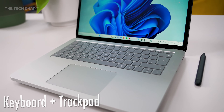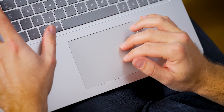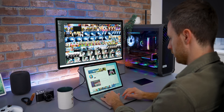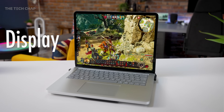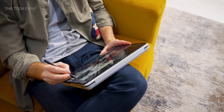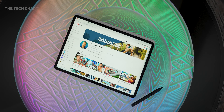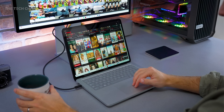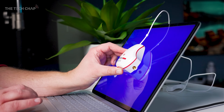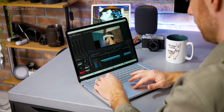Being a Surface laptop, you get a great keyboard and a big haptic trackpad. Both are very comfortable to use — the keys are well spaced and accurate to type on. The touchpad now has an adaptive mode which disables multi-touch gestures and looks for multiple points of contact and movement instead, which should make it easier for people with different physical input needs — it's kind of like an accessibility option. As for the display, it's fine. It's 1600p, it's sharp, viewing angles are great, and everything is smooth thanks to that dynamic 120Hz. However, I measured the HDR peak brightness at 425 nits on a 10% window, which tallies with the HDR400 spec, but it is very average. As for color accuracy, this hits 100% of the sRGB gamut, but only 87% and 80% of the P3 and AdobeRGB gamuts — just nothing special for a device where the screen is so key.